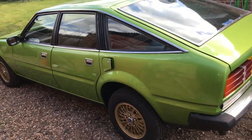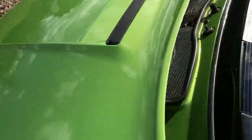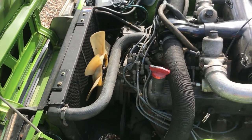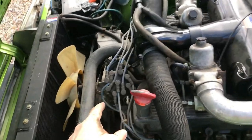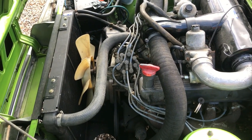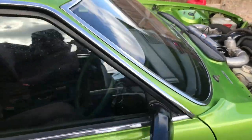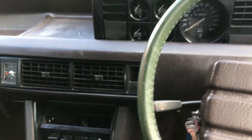I don't think I ever showed how good that dash looks now that it's all back together. That's going to be the end of this rather brief video. Things I did — or we did — but didn't film: put a different alternator belt on, because the first one was screaming, and then reset the timing. The timing appeared to be well out. According to the book, with the engine warm, vacuum disconnected, at 1200 RPM it should be 10 degrees before top dead centre, and at static it should be 6 degrees. This was well out, despite it always starting really nicely from hot or cold. The idle is now super, super low so it's not always behaving itself.